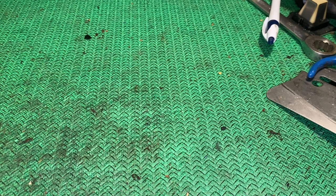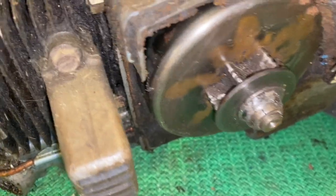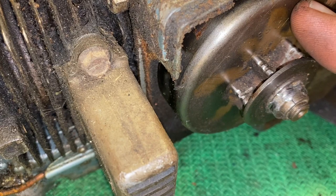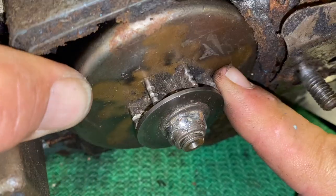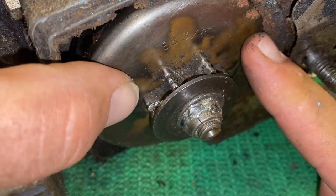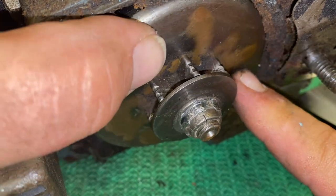This is a common style for vintage saws and some modern ones. There are issues on this one — not just that it's stripped out, but watch what happens when I turn the drum. See how the crankshaft is wanting to turn too? That happens when I turn the drum — the crankshaft tries to turn as well. This one has problems; it shouldn't be seized up like that.